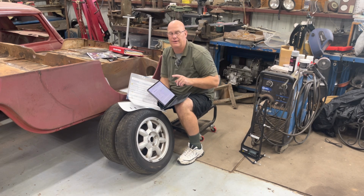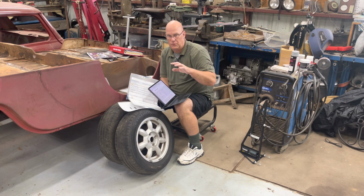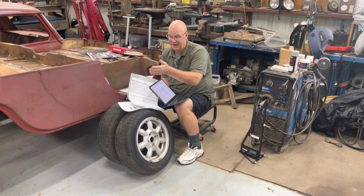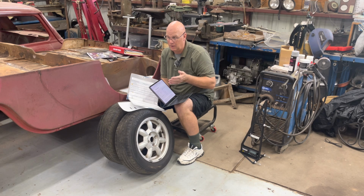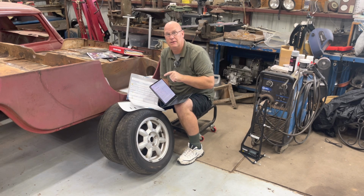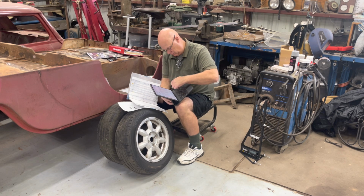So where you measure at, oh yeah, that's another thing. The Hunter alignment machines are great. They're very accurate, but they assume all tires are, I think, 29.84 inches diameter. That's not true. That's how they measure their toe. It's a standard for all vehicles. In fact, the automotive industry has used that measurement since 1979. Well, I got 19-inch wheels on the Beast there, and the rim itself is actually 20 inches across where I measure at. So you put in 20 inches as your distance, and then I want to be at 5 minutes.